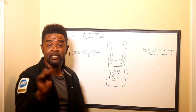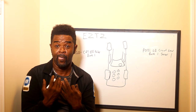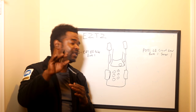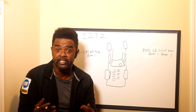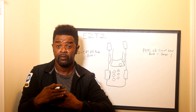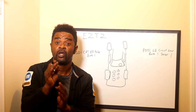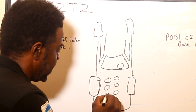Now follow me here — we're going to number these cylinders. If you know basic engine, you understand that cylinder one is always up front. That's any engine — cylinder one is going to always be in the front. If you're ever in question on where cylinder one is, you simply lean over the engine and find out which bank has the cylinder closest to you if you're standing in front of the car. If it's a sideways engine, same theory applies. Find out which bank is closest to the front because that's always cylinder one. Keep that in mind — if you ever want to know where cylinder one is or which bank is which, find cylinder one first and that will lead you in the right place.